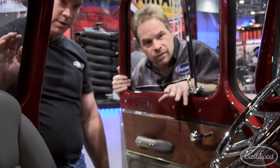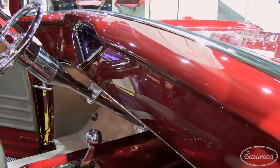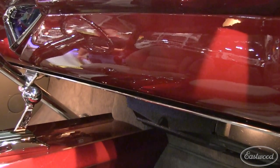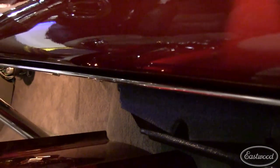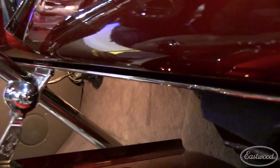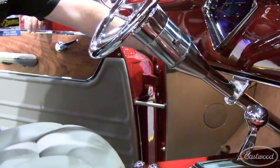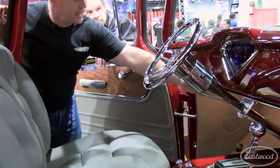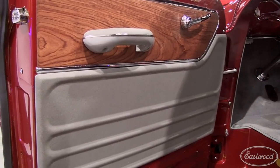The air conditioning vents — I don't see them anywhere, and I know it's got air on it. When I was laying out the air conditioner vents, I couldn't find any air conditioner vents that I liked. So I decided to make a lower vent that goes all the way along the side of the dash to the bottom of the dash. It kind of frames the dash, matching the top piece of trim on top. And then I used this surface roll here for surface tension like an airplane wing — it pulls that air right up into your face just like a regular air conditioner vent. Incredible work.